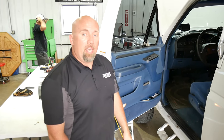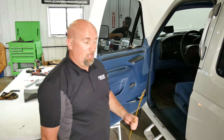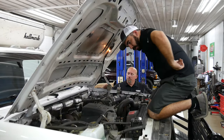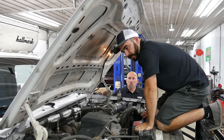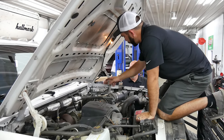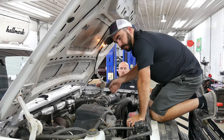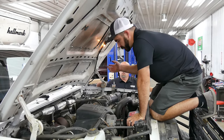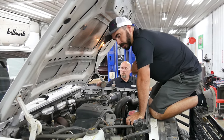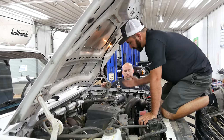Now we're going to look underneath the dash and see where we can actually get the wire through, using a flashlight and a little wire pull tool. This is another great part to have two people — I'm going to feed the wire through on the backside of the firewall, Brian is going to be inside the cab to grab the wire. That way we can fish it through slowly so there are no nicks, chafes, or kinks, and I can watch the outside while he watches the inside to make sure it's not wrapped around your steering shaft.